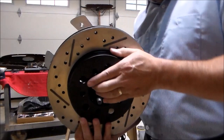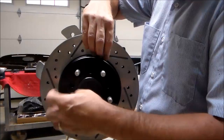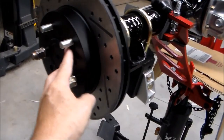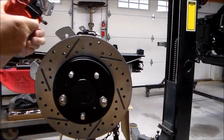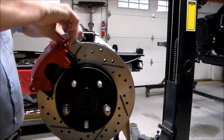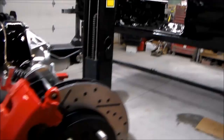So here's my rotor. I'm going to put my rotor on here. I had to paint these rotors because they came bare steel and I didn't want them to rust and be visible with scaly rust behind my aftermarket wheels, which are probably going to be open and show these. So I've got my rotor on here. I've put a couple of nuts on there so the rotor is sitting flush to the axle. Now if you can see, I've got plenty of clearance between my rotor and my bracket that holds the caliper, and there's my caliper bracket there. I'm going to get the caliper and put it on, and as you can see I can basically put this whole thing together with my fingers. So I'm going to bring the camera over so you can see it now.